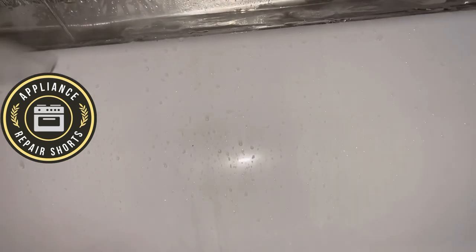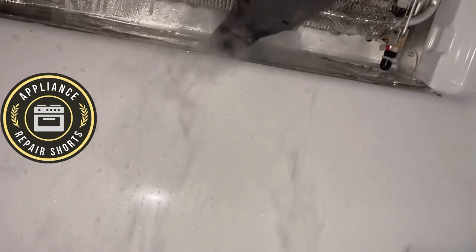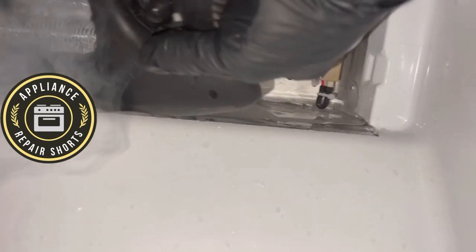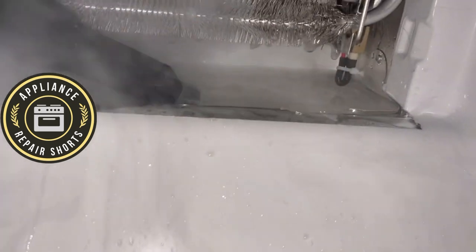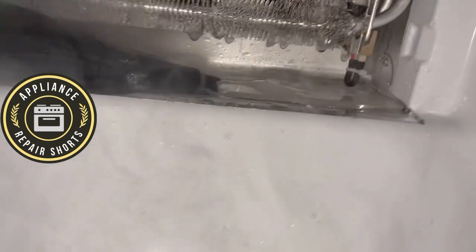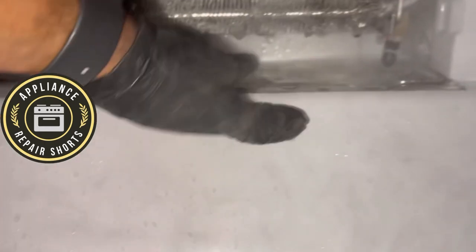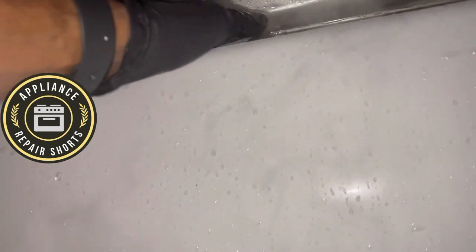So that's going to be pretty much it for this video. I just wanted to share that if you have a situation where you need to get the drain unclogged, you have to go deeper than just a surface defrost. If you pour water in after you unclog and the water is pooling, your drain is still clogged — get back in there and redo it. Super hot water is totally fine. Make sure you unplug the fridge — do not work on a unit while it's live. Thanks for watching and hopefully this will help somebody out.